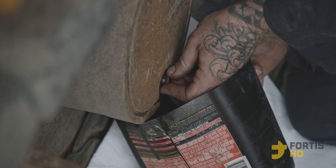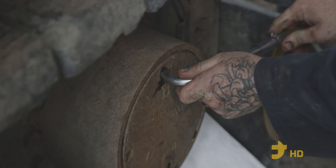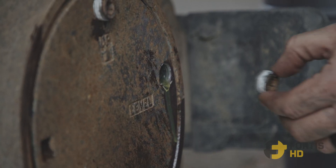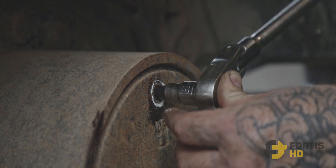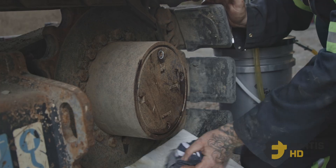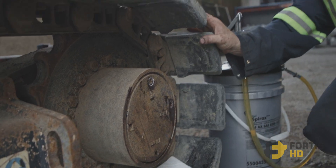Check the description for the link below. Once it's done draining, reinstall the bottom plug and start filling from the top plug with fresh gear oil until it drips out of the level plug — dribbling out there. The oil needs to work around the gear, so make sure you see the oil level stay just below the level plug. Give it a good clean so you know what's old and new oil for leak checking purposes.